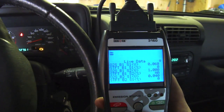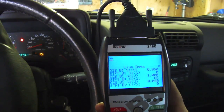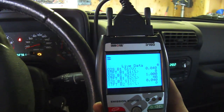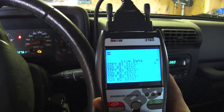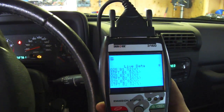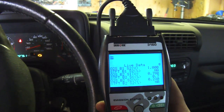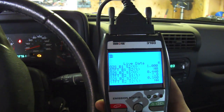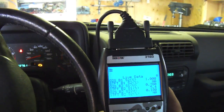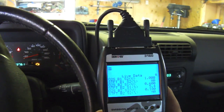So we look at here — we got our data right here: .40, 1.0. You need to go to bank one sensor two — it's reading one. And bank two sensor two, see how it's bouncing around? But bank one sensor two just stays at one.